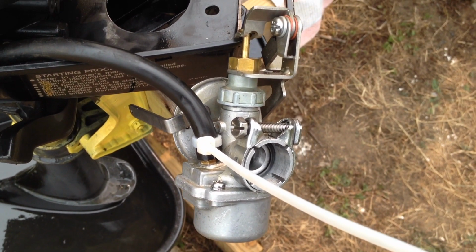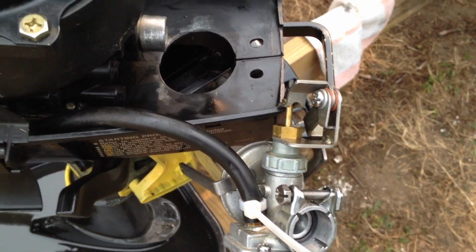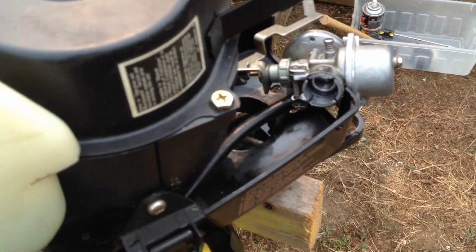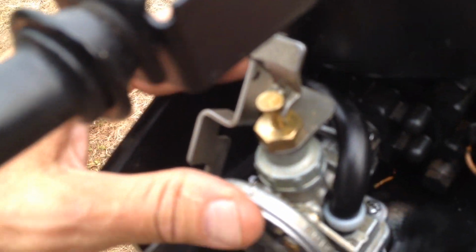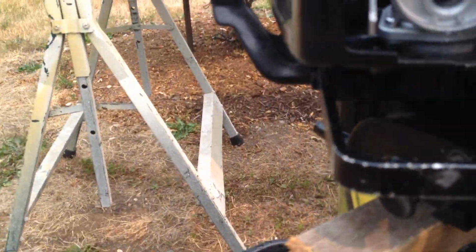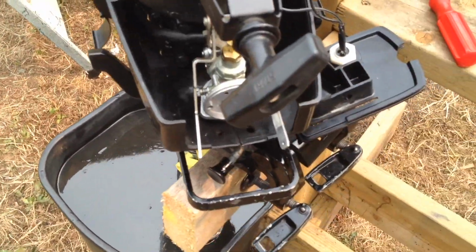All right. I'm going to remember that O-ring. Tip in the fuel reservoir. Slides over the intake. Make sure that you really slide it in because it'll hang up pretty quick, and obviously you do not have a seal. And don't press on the front because then you'll distort that choke diaphragm.